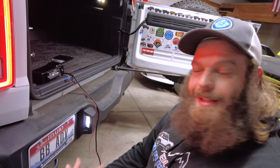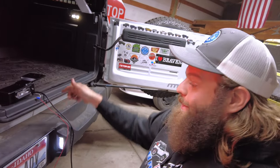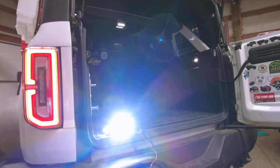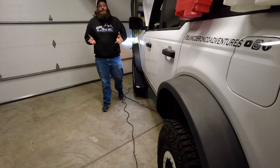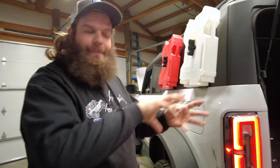We're going to tie the runner light into the runner wire that's already in the trailer hitch portion of the Bronco. If you didn't have the trailer hitch option, just tie it into your tail light runner wire — or run it all the way to an auxiliary switch if you want. These runner lights are meant to light up behind you on the trail. Let me show you how bright it is — that's pretty good, lights up the rear end. Our amber light will be the runner light; we're tapping off the spare tire light wire. These pull like two amps — nothing, four total.